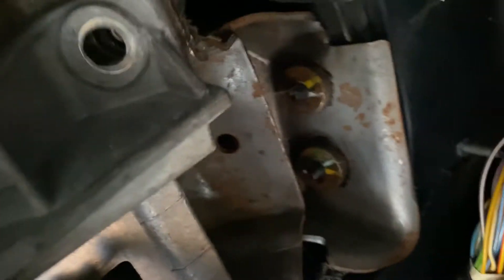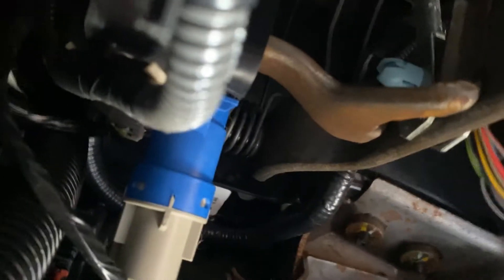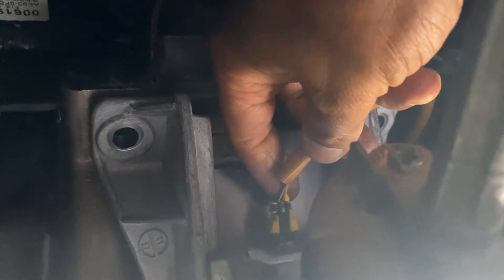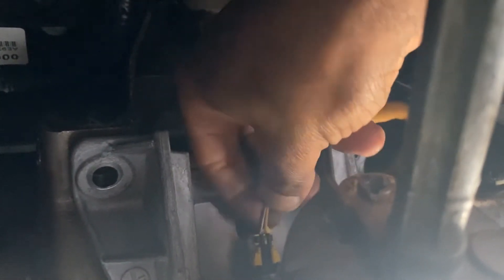There's a T10 back there as well. The sensor itself — if you want to see it — that's going to be the yellow cable behind the steering column. This one. It's very hard to reach, and there is a plate on top of it between the steering column and the dashboard. The easy way I found is to take the steering column down, then take the top screws with a T20 torx and remove the sensor.